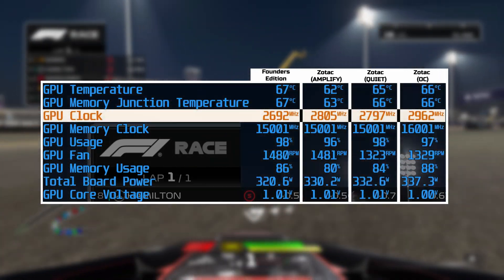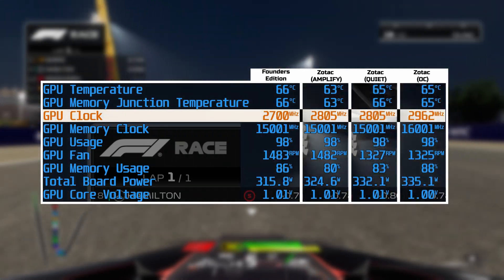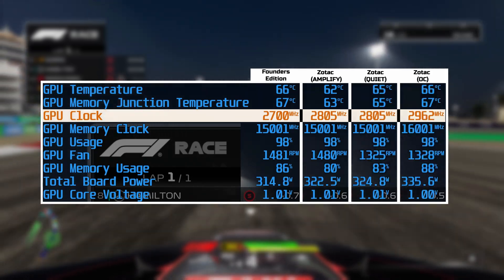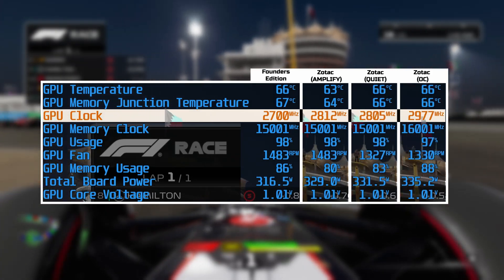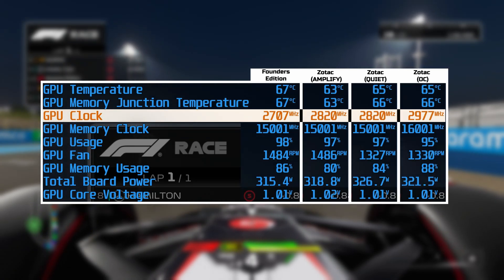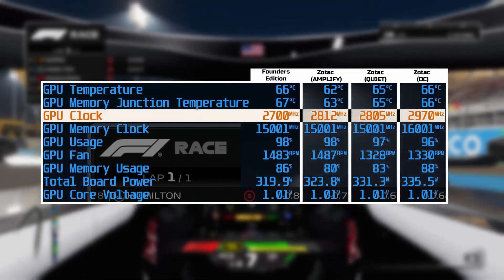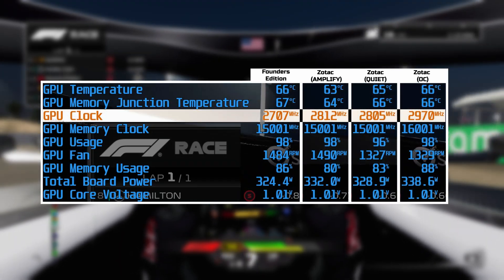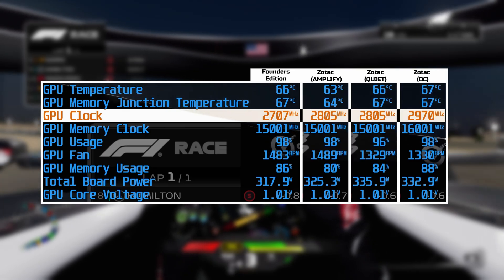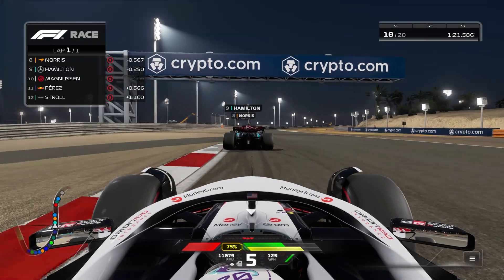When we look at the overclock, power draw increases again to an average of around 340 watts. Looking at clock speed, the Zotac increases the base clock seen on the Founders Edition by around 120 MHz on average, staying pretty consistent with Quiet mode too. Overclocking did allow us to push the core clock up by 250 MHz, which translates pretty well to the real-world clock. On memory, we were only able to see a 1000 MHz increase over stock, and any further increase due to GDDR7 having ECC actually caused performance to drop.